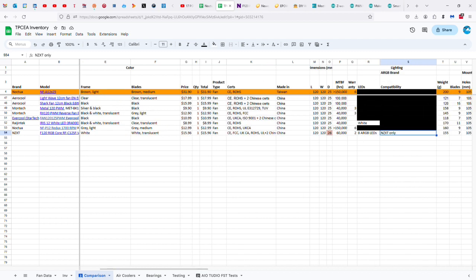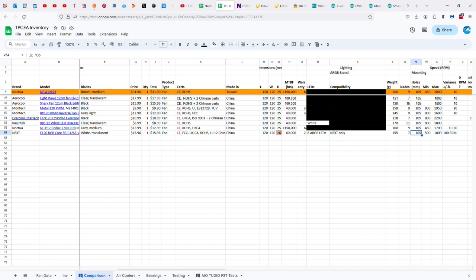So if you want to plug it into your motherboard, you have to have an NZXT motherboard, or you have to make your own adapter which I believe involves using a resistor on one of the wires. 155 grams versus 200 for the Noctua. Seven versus nine blades. Standard mounting hole distance. 500 to 1,800 RPMs versus 450 to 2,000. Instead of 10% like the Noctua, they say plus or minus 180 RPMs. I don't know if that's maximum or minimum — that seems pretty shoddy if it's ±180 for 500 RPMs; that's way more than 10%.